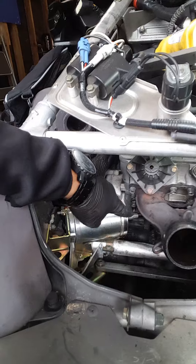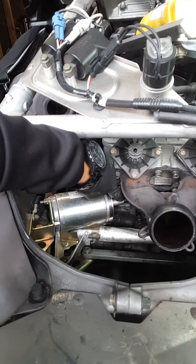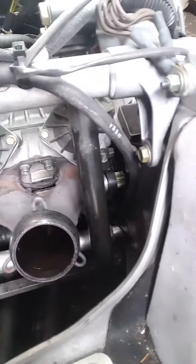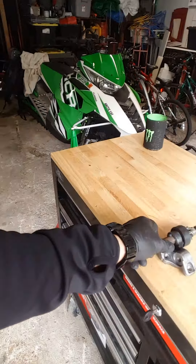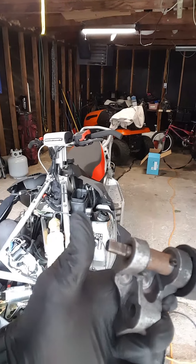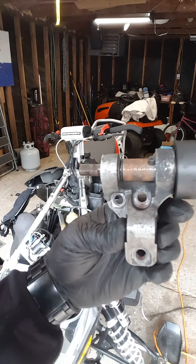The way this works: there's a starter, and then there's a drive shaft — or flex shaft as Polaris calls it. It's a flexible drive that goes over to a unit which is a three-piece kit. I'll show you a close-up. This is the end of the cable which attaches here; it bolts with three bolts using a six millimeter Allen.